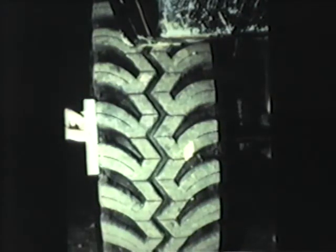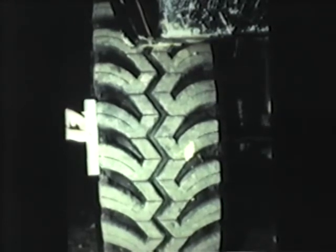The tire itself may be a directional design, like some of the designs on the high-performance radial tires now on Corvettes and Toyota, Nissan high-performance vehicles or Porsches, anything like that. They usually have an arrow on the side telling you which way to mount the tire. When the tire is at the top of its cycle, that arrow has to point to the front of the vehicle. The V has to point in an impression. When you look at the impression, the V tendency of the pattern will point to the rear of the vehicle. I mentioned that the first day.